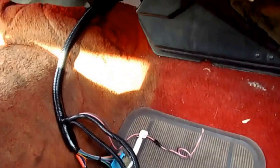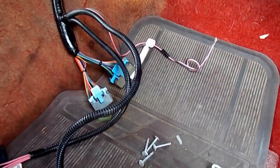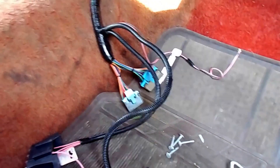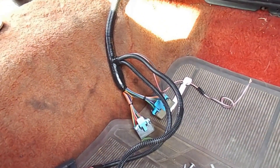There's the power from the ignition hanging down that we need to tap into. Need to throw an idiot light at it somewhere. Other than that it's coming along pretty quick. The throttle body's going in, the O2 sensor is already in, and the fuel pump is already in, so that shouldn't take long either. Just need to wire them into the new harness.